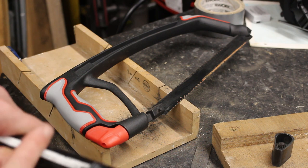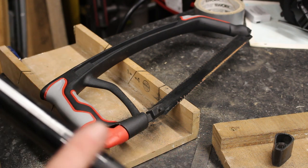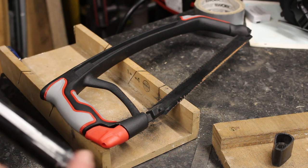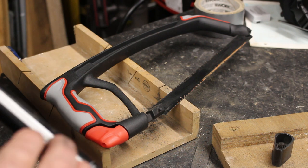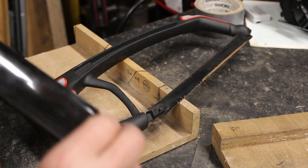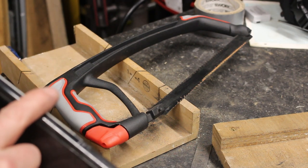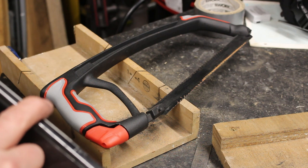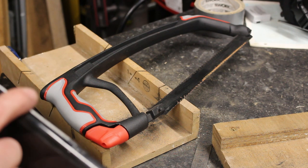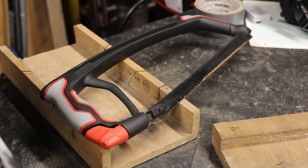So that's the other thing as well, because that's the bit we don't know, that this seatpost hasn't already been cut down, so that minimum insert line really wants rubbing off, and you shouldn't use it as a guideline, because I would say that as a minimum insert is probably too short. I would have probably said about that much in the tube, because otherwise you're putting too much force on that little piece. So I'd say probably there with that on.